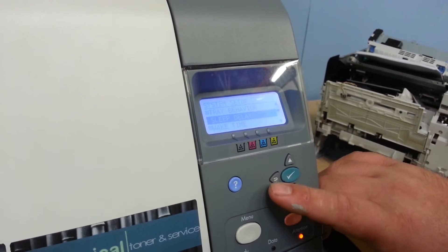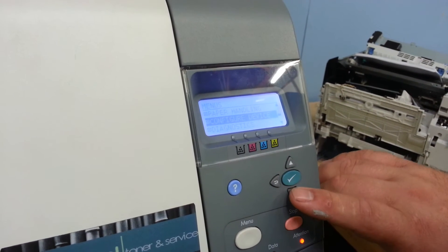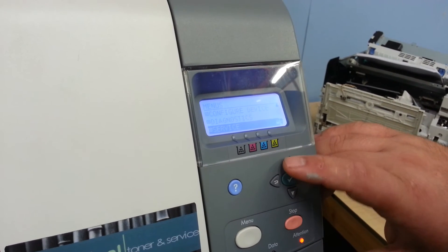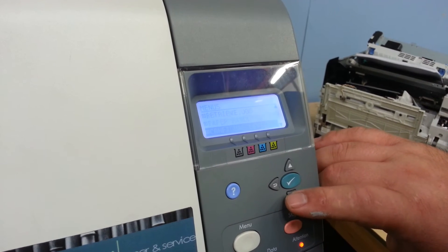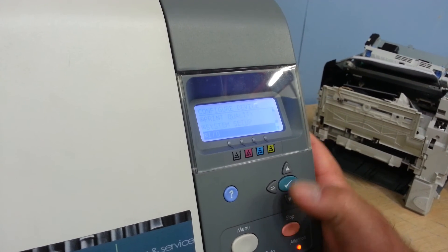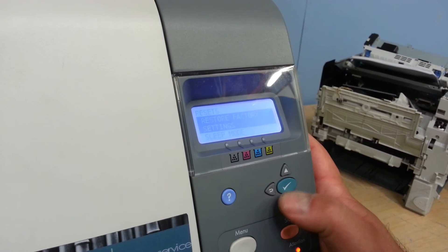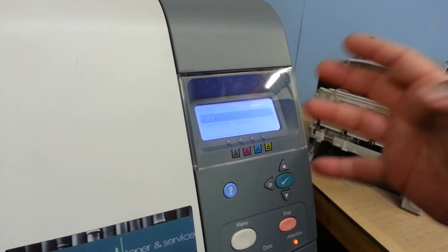You can do that, or if you back out of this and go back into configure device — sorry — go back into configure device to that menu, and instead of going into system setup you scroll all the way down to resets. If you click on resets and go to the sleep mode tab, you can turn sleep mode on or off.